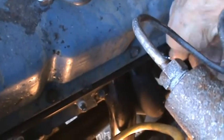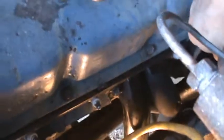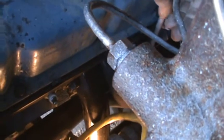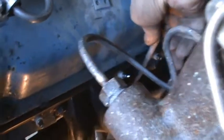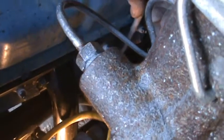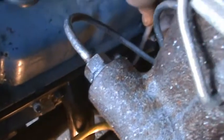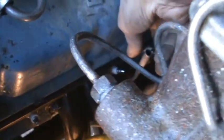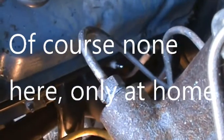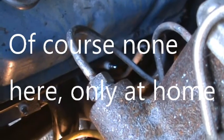I shouldn't have put that plate on yet. But I don't see how that wouldn't leak oil. I was having trouble getting the tube down into the block, and I didn't want to put any silicone under it at the time because I didn't think I was going to be able to get it in. But I'm going to try to just pull it. Oh yeah, it pulled up pretty easy. I'm going to crawl under there and put some silicone around it and shove it back in. At least that'll stop the oil leak, hopefully.